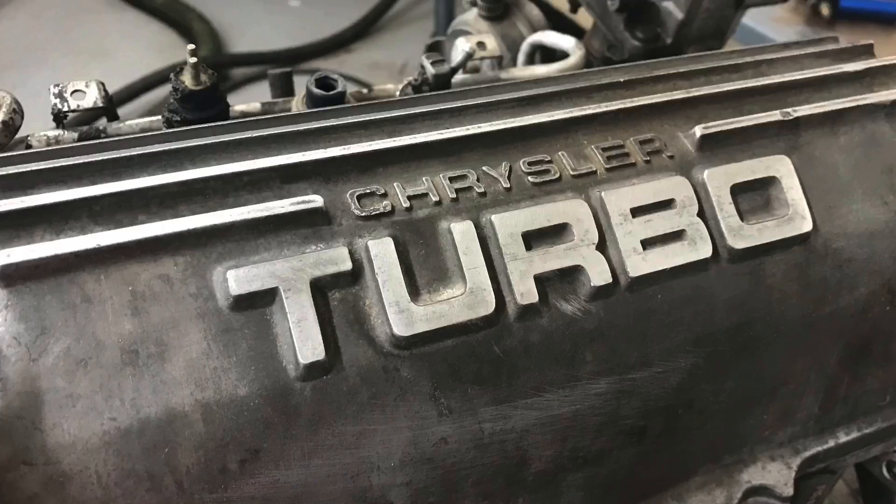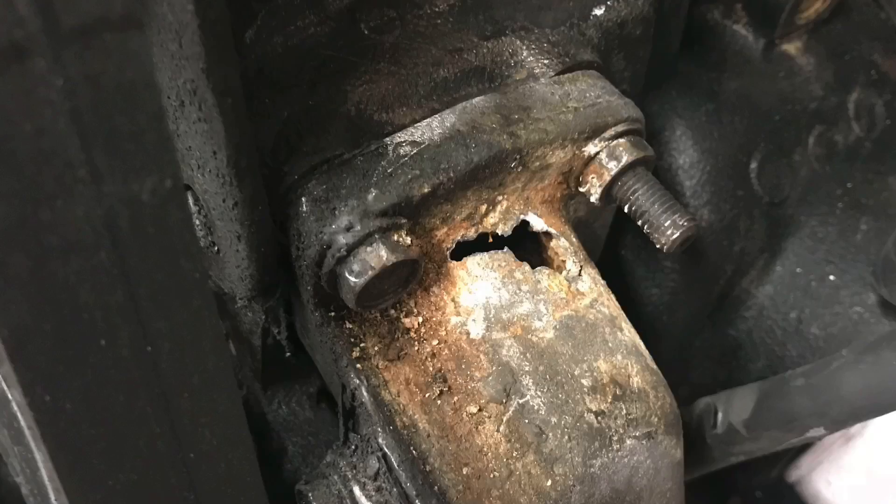So what did we learn in our step-by-step leak down process on our 2.2 liter Dodge Turbo Motor? The first thing we learned is that you're always going to run across problems no matter what. Before we put a motor up on the dyno, we like to find out: does it have the pop that we need? Our 2.2 liter actually looks pretty good — it had fairly even and consistent compression on all the cylinders, which we like to see. That means as soon as we solve all these other problems — getting the bell housing, getting the flywheel, fixing the leaks — we can put our 2.2 liter motor up on the dyno and make some noise. Make sure to like, share, subscribe, ring the bell. I'll keep testing.